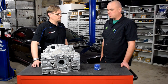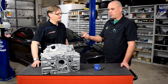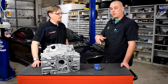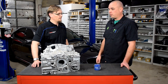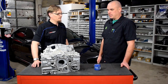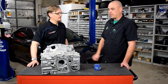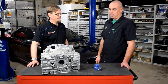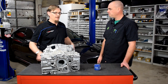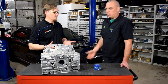For whatever reason, this motor just would not build oil pressure. We pulled the turbo feed line just to verify that it wasn't a sensor problem and that it was actually an oil pressure issue — and it was. We were not getting any oil there at the turbo. We pulled the oil pressure sender unit and verified at the block that we were not getting any oil pressure there either. So we started to diagnose why the pump wasn't priming.